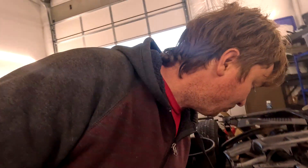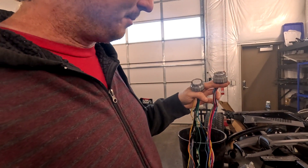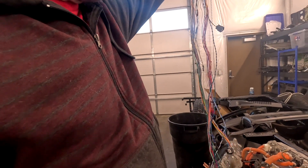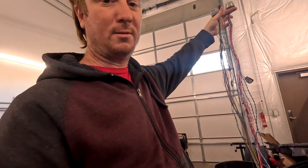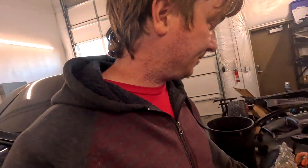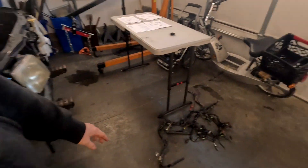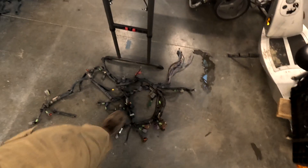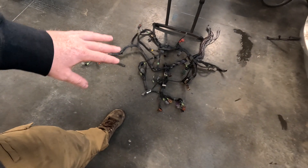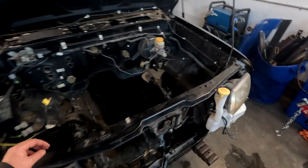I've also been cleaning up the wiring from the Nissan Leaf loom. We've got the one here for the inverter, the one here for the PDM, and these are the wires that tie into the different systems — the 12-volt, the Resolve EV, the CAN bus, etc. We also have the wiring that goes to the motor position sensor. You can also see all of this wiring that I cut out of the Frontier — this is all the engine bay wiring we're not going to need: fuel injectors, the distributor, sensors, the alternator — all gone.